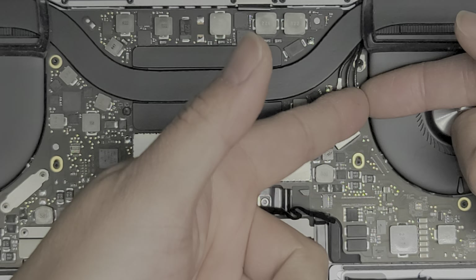After you remove that plate, pop this connector up — you can use a plastic pry tool or just use your fingernail under here, just like that. Switch back to the T5 to remove these two screws. Sadly I messed up one of my T4 bits so I'll have to get another one. So now we've got most of it — we're going to have to remove the wireless bar here.